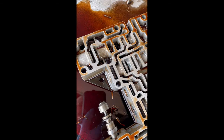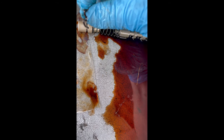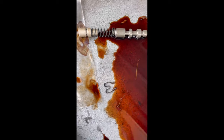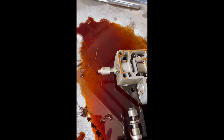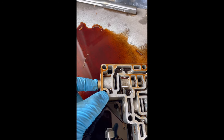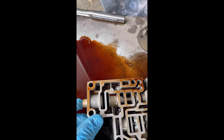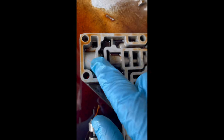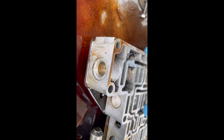The first part of the instructions says to release the pressure valve. There's a little clip in here — you're going to pull that clip up and it'll spring out. The instructions say to replace this spring with the blue one provided. We're going to go ahead and replace that, reinstall it all back together, and clip it in. Be careful you don't scratch the bore. Push it all the way in using the end of an extension, then lock that little clip right back in there to hold it in place. Now that is back installed with the clip in place — you can see the blue spring is compressed in there, recessed quite a bit.